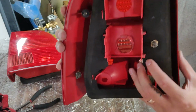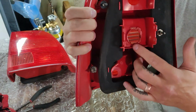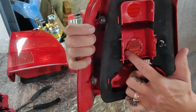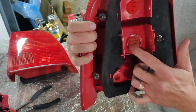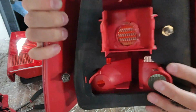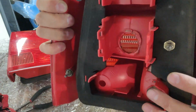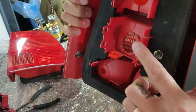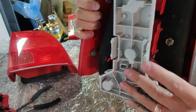And here's the aftermath. It's a little difficult to get in there with the plastic welder. You have some inherent risk of getting some heat exposure here. It's not too big of a deal as long as you don't close in your ID at all, but if you do, try to clean it back up. The biggest thing that you don't want to do is damage these guys where the bulb tray will clip into.